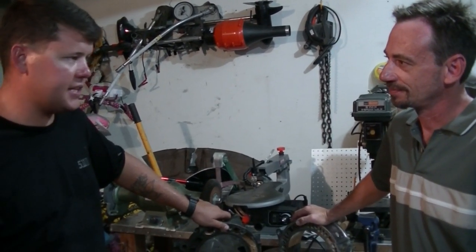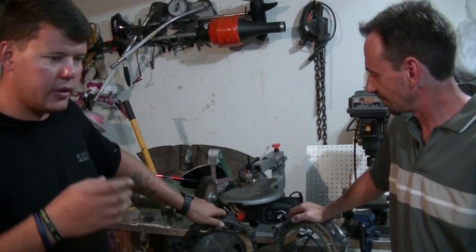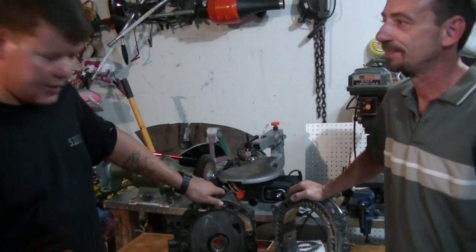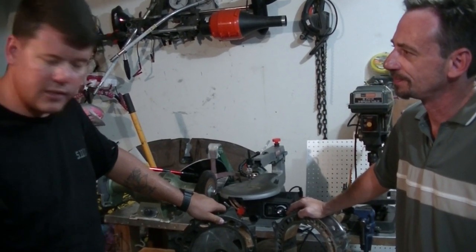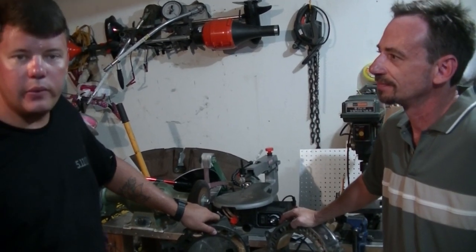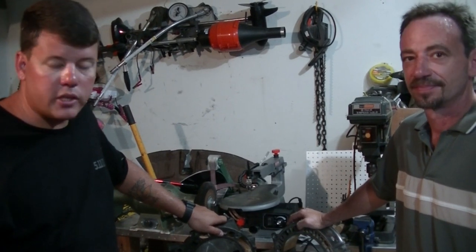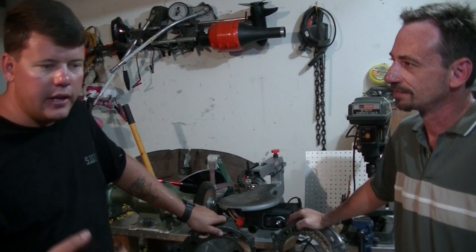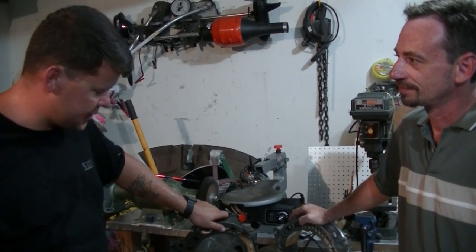Oil and fuel are always mixing. The exhaust and intake overlap is that of a two-stroke. It's piston ported, so to speak. Exactly. Everything has the characteristics of a two-stroke. So again, like us rotary guys say, this is our four-stroke two-stroke. We put oil into a pan just like you do. We fill our oil the same way you do. We check the oil the same way you do. Thus, we have more experience and want longevity out of our motors. The only thing different that we do is add that premix. And that premix is just great for startups and protecting the apex seals.